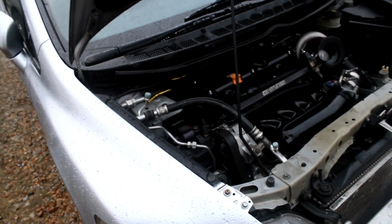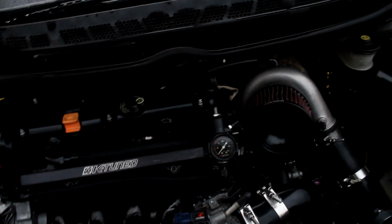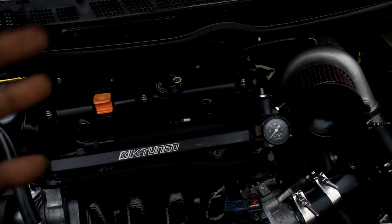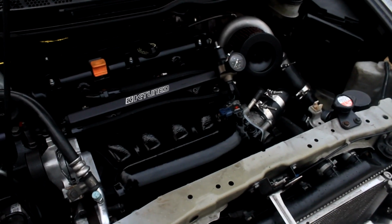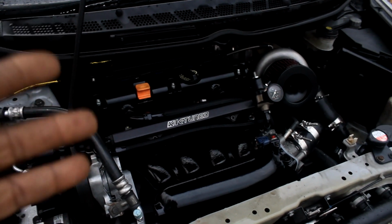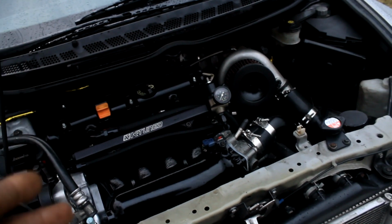So the flywheel, I took it to a local machine shop, and I asked if they could resurface the flywheel. And again, this is my fault. I treated the flywheel as just a regular one, you know what I'm saying? You take your flywheel to the machinist, get a new surface, yada yada. My conclusion is, and I still need help on this, guys, because I don't know what the problem is, but I think that's the problem. Obviously I have a slipping clutch, but I don't think those discs are already worn. They're brand new.